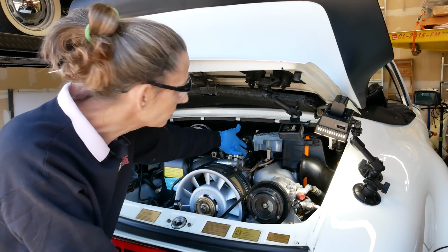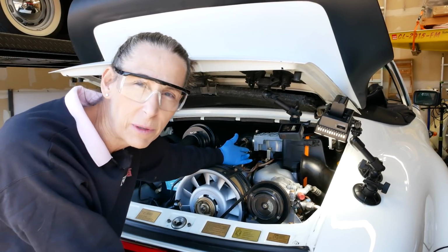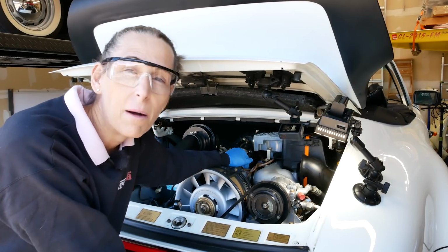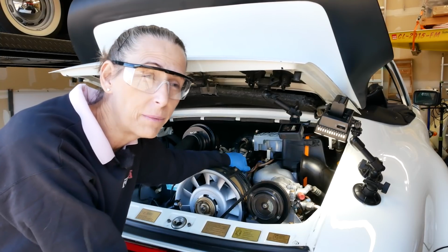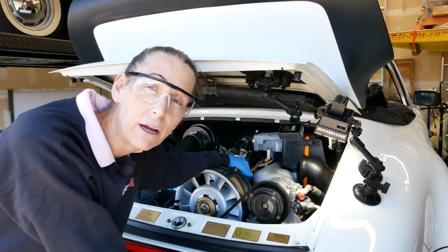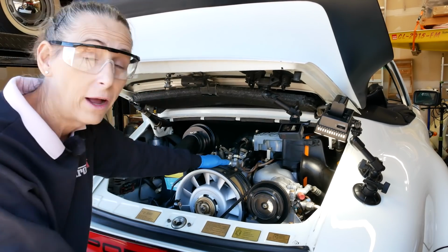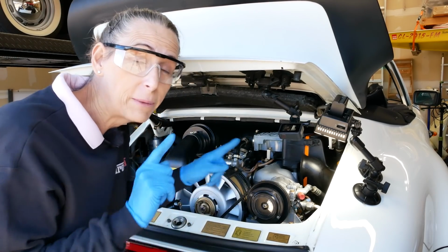But every time I pull this plug on it, the RPMs speed up like they should, and I put it back on, it goes back down, but we're still idling above 1,000 RPM. But remember, on my drives, I also said, you know what, it sounds to me a little like we're missing a cylinder. Well, I think I found it. Hold on, let me get the car started.